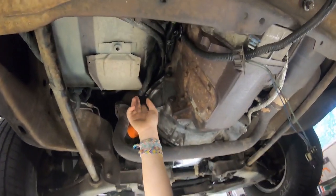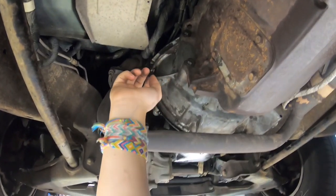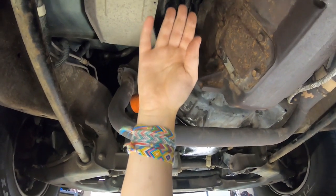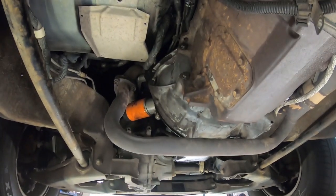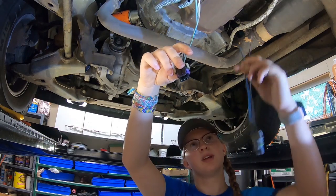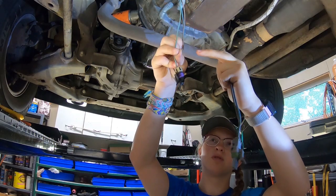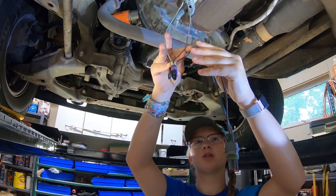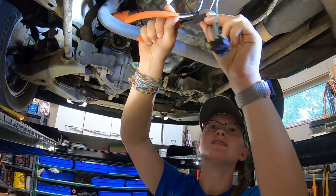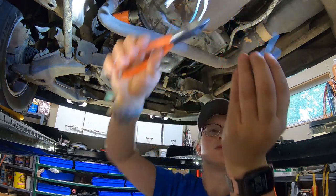Here's the main harness — the rear lights are plugged in, the O2 sensor is plugged in, it's plugged into the front hub harness, and we also have the speed sensor plugged in. The automatic had three wires going into the plug, but we only have two wires from the manual, though the colors do match. So we're just going to ignore the green wire and hopefully it doesn't do anything important for the manual. We're going to hook these up and plug it in.